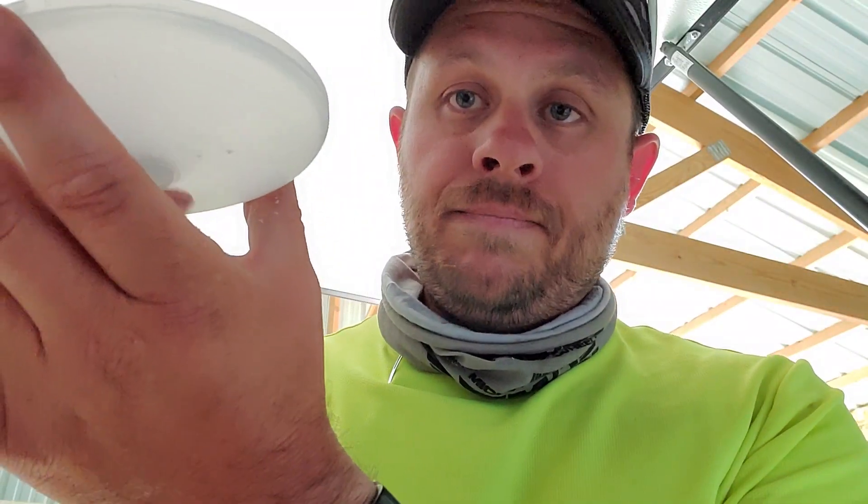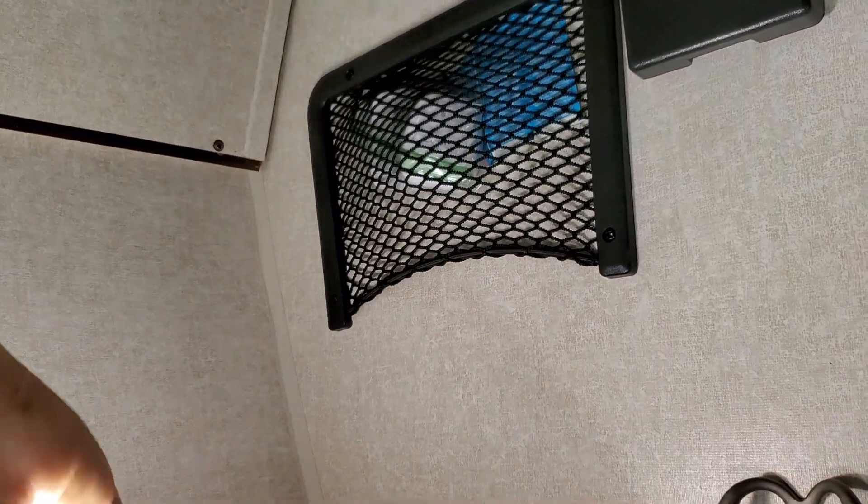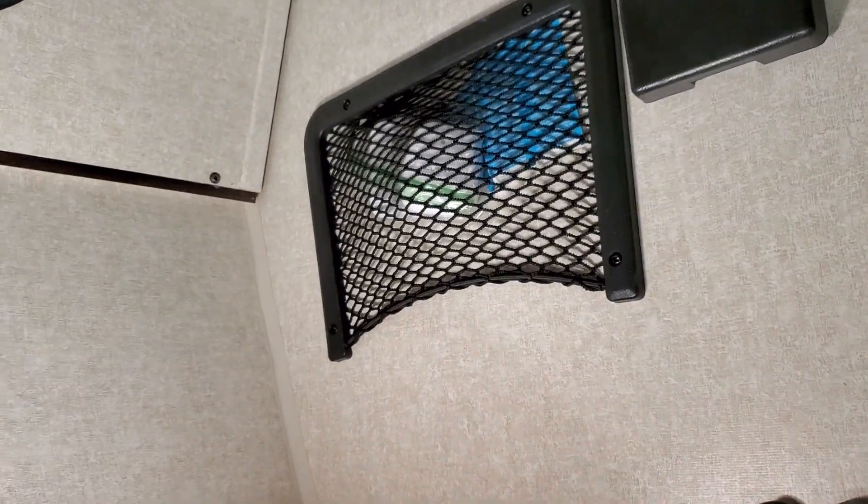Then reinstall using the opposite steps. There are some detents right here that you'll need to make sure go in the proper location. You can kind of see how this is shaped. And push that thing back in there. What we have now is a mostly functioning light — let's test it and see. There's our light. You've got to get these little detents also lined up — there's a depression in each one of these, so you want to make sure those line up. Spin it back on.